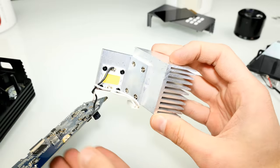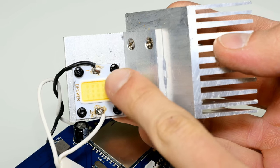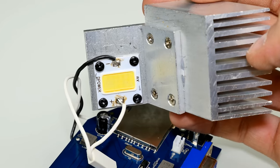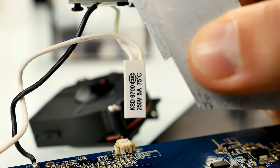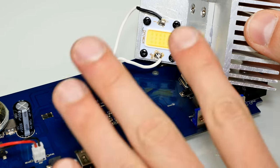Let's have a closer look at the LED — here it is, the actual light source of the projector. So it's a real LED projector — I thought there might just be a lamp inside. There's an LED mounted on the heatsink with some thermal compound. The heatsink is actually quite big — it seems that the LED dissipates a lot of heat. In reality, if you really want to watch a movie it has to be completely dark, otherwise you can forget this projector. Maximum input is 2.5 amps at 12 volts — about 30 watts maximum total power consumption. That's the heart of the projector: LED, heatsink, and the motherboard.